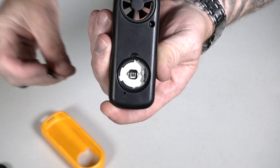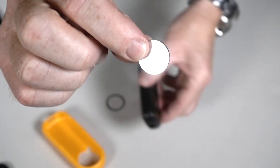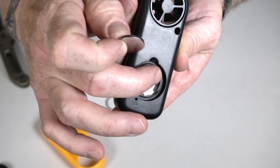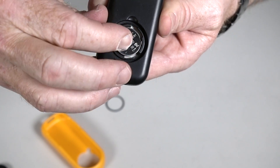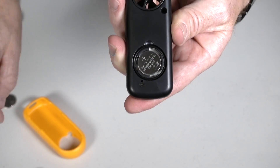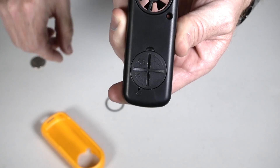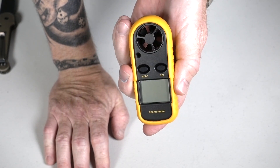The top part is the positive side, and that's the negative side. Your instructions tell you nothing about which way this goes in. Because we bent those tabs up, that's the negative side — make sure you're pushing it aside so you're pushing into that tab and not bending it back down. With it facing the right way, I'm pushing in from the side, making sure I'm pushing that tab up against the side, snapping it into place. There's a little rubber ring — that's the weather seal. Make sure you get that in there. This goes back up and it's just about a quarter turn clockwise, which locks it into place. So if your unit wasn't turning on, that's likely going to be your problem — one of those battery issues I just showed you.